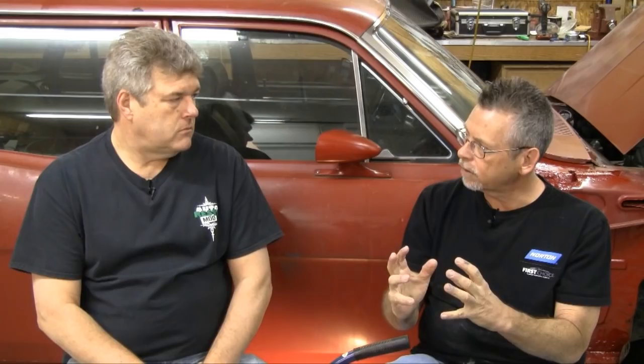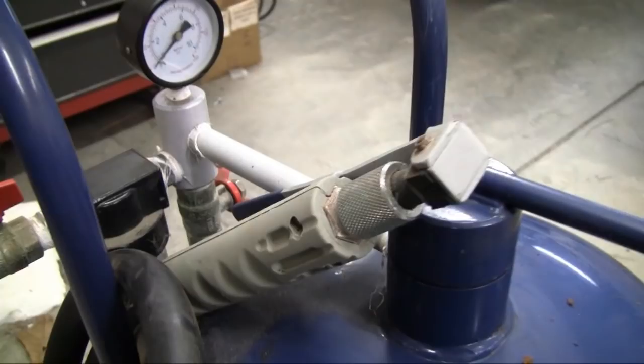What happens is the particles are so fine, it takes a really long time. A commercial system uses a large volume of material — a whole lot more than you're going to get out of this pot. Whether it's plastic, black beauty, or soda, any of these use a large volume of material with low pressure. That's why you don't sandblast — because sand uses small volume and large pressure. One of the other things we ran into was just the amount of material used and how to dispose of it, because it goes everywhere.